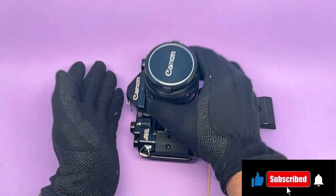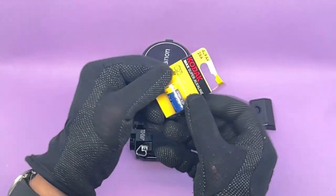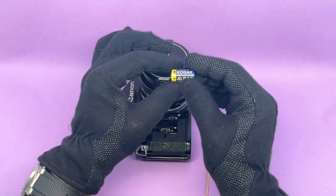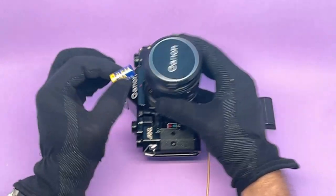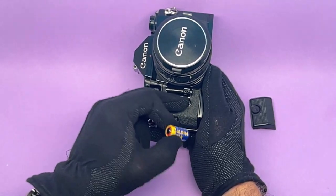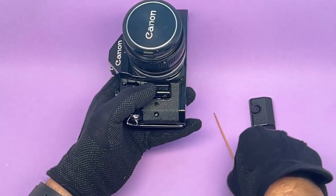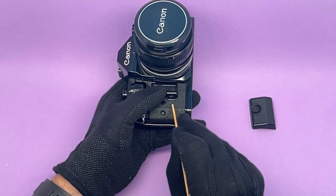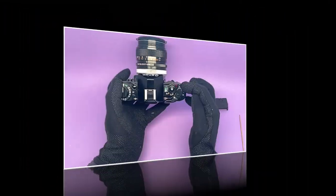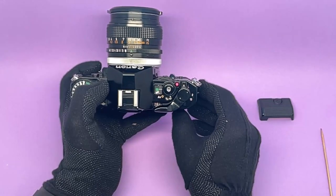To test this camera further, we'll put a new battery in — this time from Kodak. Positive is on the left, negative is on the right. The best thing is to put the negative side in first, because there's a pressure tab on that side — putting it in the other way would bend the tab. So put the negative side in first, press it in, push it down. Then put the tab on A — the on position — and press the battery check button. It rapidly blinks, which means the battery is perfect.